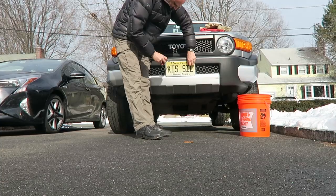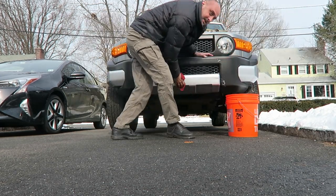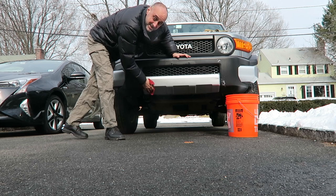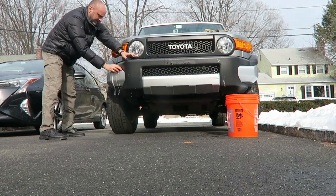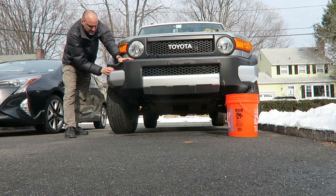The first thing is to start with cleaning up and prepping. Take the license plate off, cleaning, drying, and then start coating. Clean it really good. You don't want any oil or any residue or any dust on it, so the PlastiDip doesn't stick. I'm specifically only cleaning the gray, the silver area where I want the PlastiDip to adhere to.